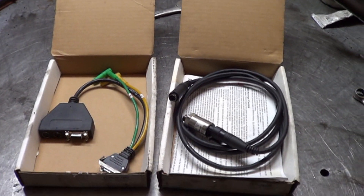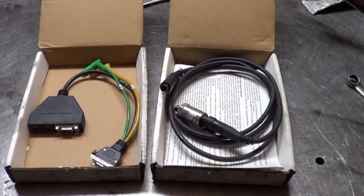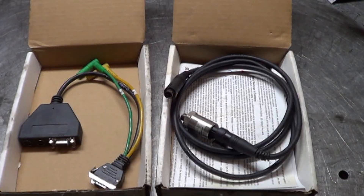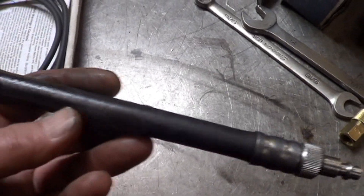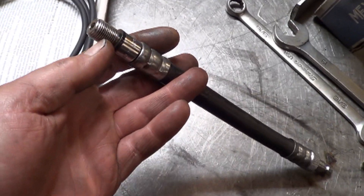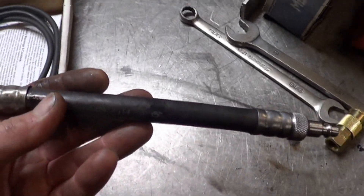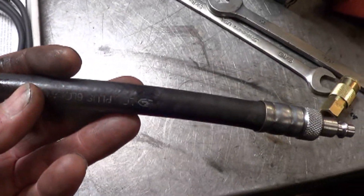The first step is to get it connected to the cylinder. This looks like a quarter inch pipe on the end of it. This is my adapter hose that goes with my compression gauge — it's a snap-on — and that'll screw into most of the Volkswagens. It screws in where the spark plug goes on most of the Volkswagens we work on. I figure I can use this coupled with that to do in-cylinder pressure testing.